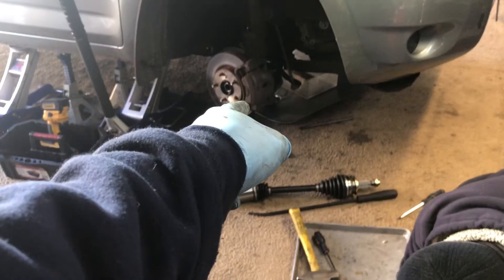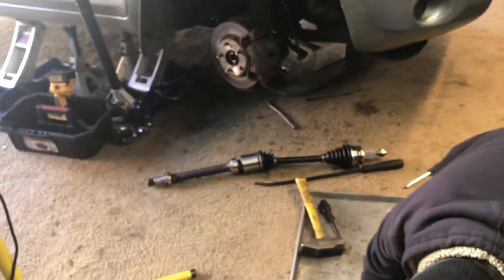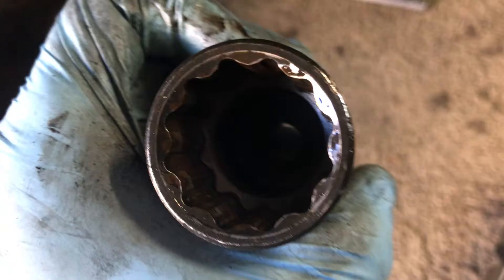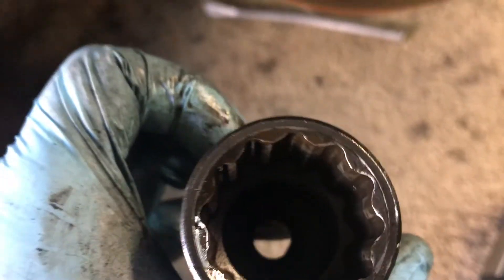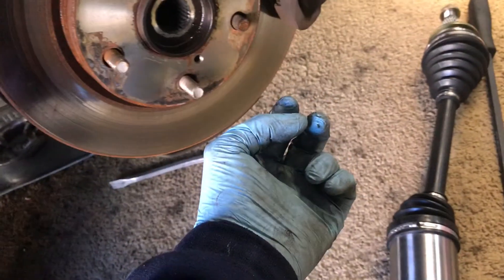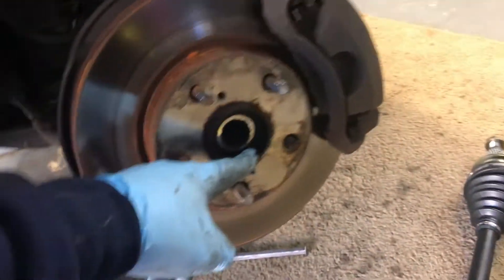It's two 14-bolt reverse bolts that hold the disc bracket inside the carrier bearing area. Then three 17s hold the ball joint. There's also a special socket that you need for Toyotas to take them off — this little socket right here cost me $100. See how it's rounded in there? No regular socket will fit this nut. But the replacement one, they give you a regular nut. So three 17 bolts for the ball joint, and that special nut — if you're working on a Toyota, you need that special socket.